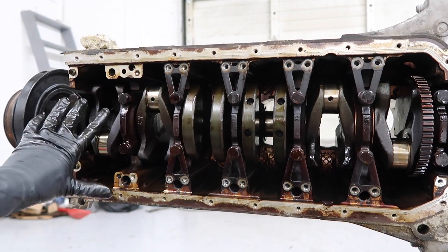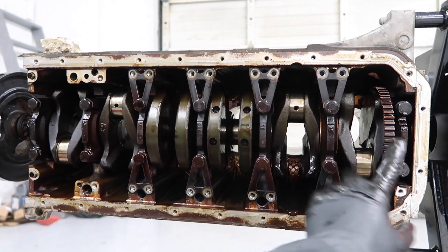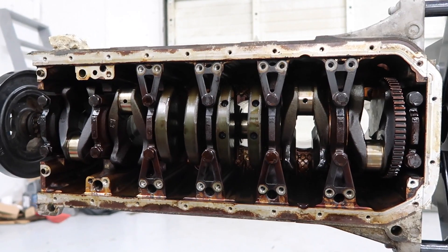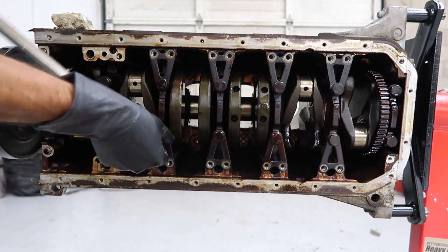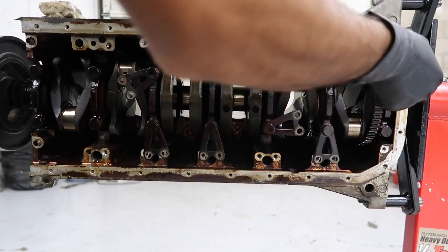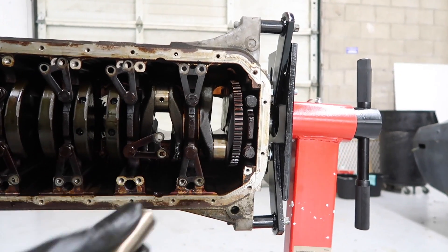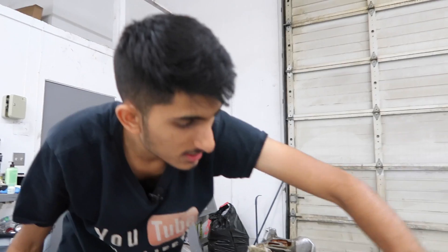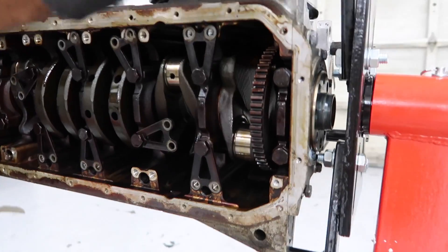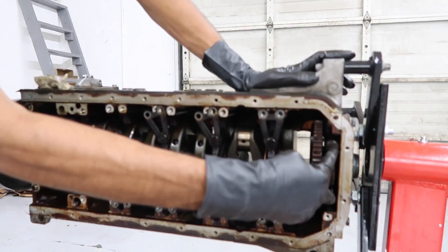There's the last one. Now we're going to go ahead and remove this crankshaft. These are the bearings for the crankshaft — all of these. Let's go ahead and pull those off — those are all 17mm bolts and they are going to be really tight so you're going to use a breaker bar. This is the rear main seal cover, which is why it's causing the socket not to fit all the way. In order to get off these two last 17s I have to remove the rear main seal cover, and in order to do that I have to take it off the engine stand.